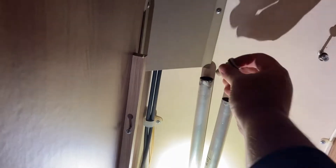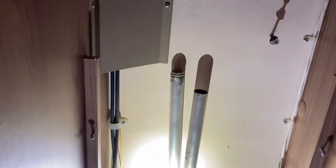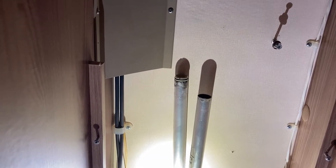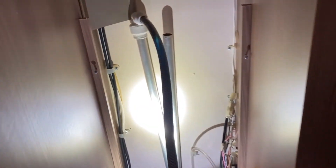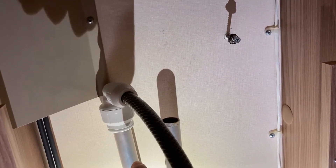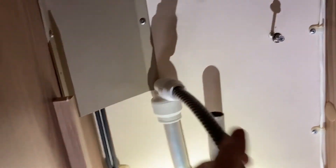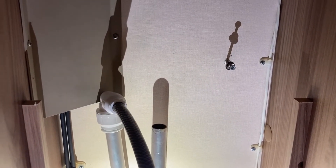The pipes in the cupboard - the longer one is the infeed, this is the outlet. I'm going to put my infeed in first and put my insert in there. Then I'm going to get my John Guest fitting with the hose and attach it on the other side. I fit that on the inlet - I couldn't video it because this cupboard is so narrow, it's difficult to get two arms in it. I've pushed this on, pushed it as far down the pipe as I can and then tightened it. So I've got my inlet ready to go. I can do exactly the same now with the outlet and then hopefully start filling.